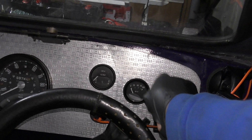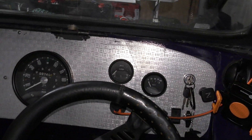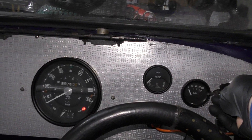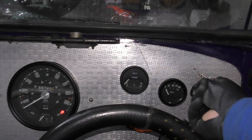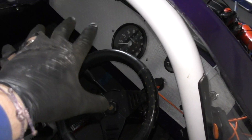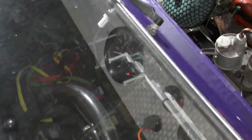Here is the fault we had previously — when we turned the key there were absolutely no lights on the dashboard, no lights on the engine, no electricals at all. So when I click into the first position, we have an ignition light. And when I click into the second position — which I won't do now because it's still very early, sort of pre six o'clock — when I turn the ignition switch on, we have power. We can test a few things now actually.